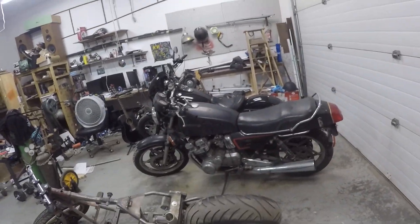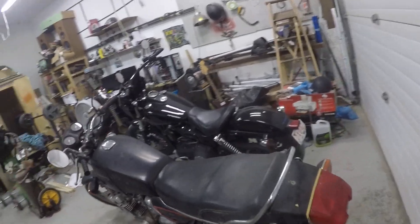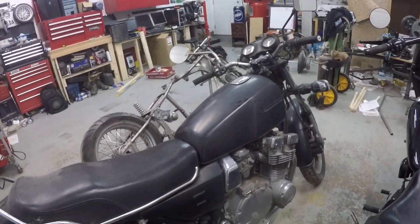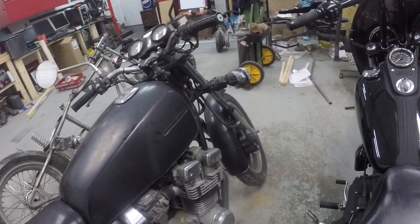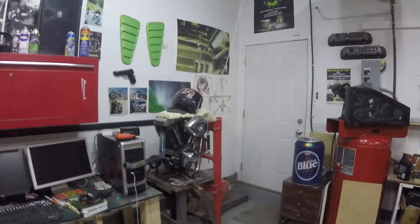I have lots of parts and I don't think anybody's going to want to resurrect that bike, so I might as well use whatever I can off it - I don't have any papers to get it registered with anyway. I'm going to pull this cover off to see if it's got points or if it's electronic, maybe using a CDI box or whatever they call it. If it's got points in there, maybe I can make a makeshift set of points for that engine over there - points are cheap but initially for the first fire-up I might be able to fabricate something.